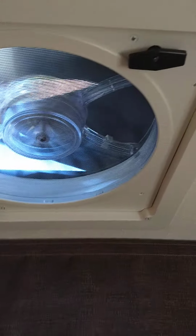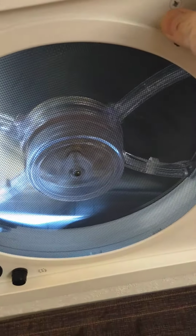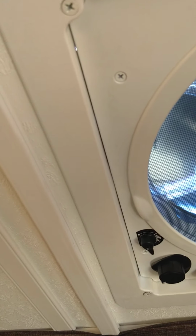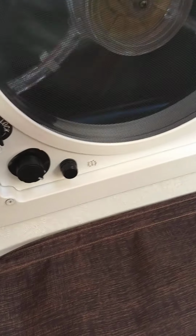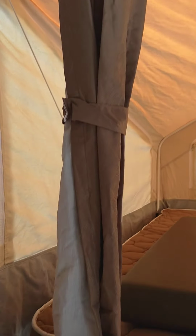You have a 3-speed fan, right? Always make sure you close it with this before you bring the camper down, otherwise you'll have to crank it back up to do it, because you can't close it from the outside. So you'll close it. It's got a kill switch on it, by the way, but I'll shut it off. You close it, and then you lock it like this so it can't float and rise when you're pulling it down the road, okay? All right. That's just your furnace there.